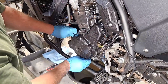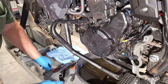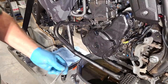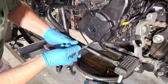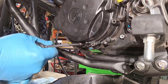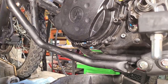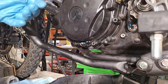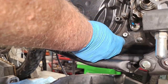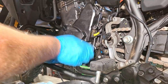The outer cover is a little bit hard to get off. There's an O-ring on the balancer adjustment bolt that fits the inside of the case really tight — loosening that usually makes the case come off easier. I wanted to leave it tight to see if the system would adjust when we took the cover off, but I didn't want to fight the cover on video. Some resistance you're fighting is that O-ring, plus the magnet and the stator pulling together.